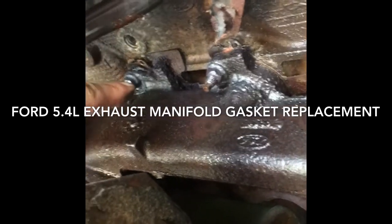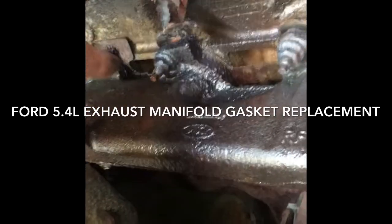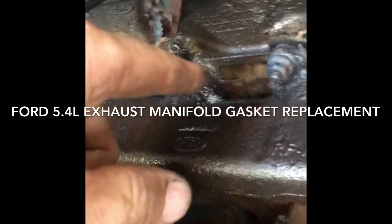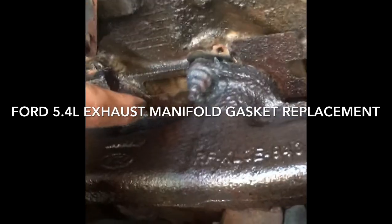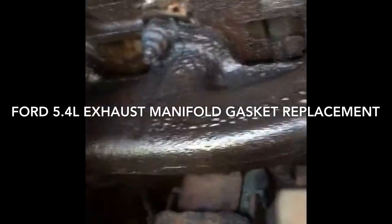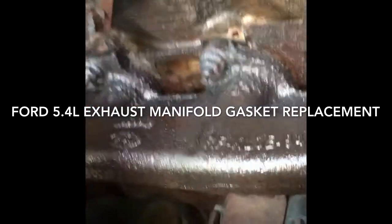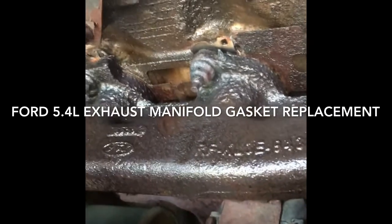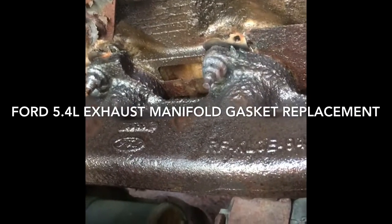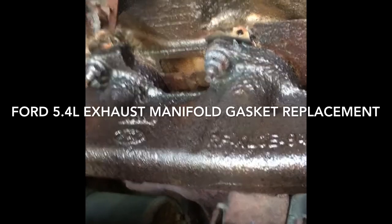Last night I had him take this for about a 10-mile drive. He came back and I soaked the whole thing in penetrating oil — absolutely doused it in PB Blaster, went through almost a half can. I've come back now, those two came out real easy. This one I just managed to get broke loose. All these top three I've heated up with an acetylene torch, got them red hot, doused them with penetrating oil again to let it suck in and soak in.